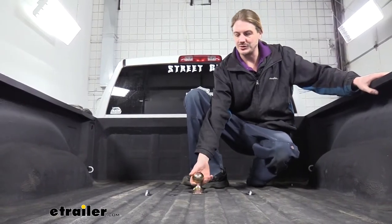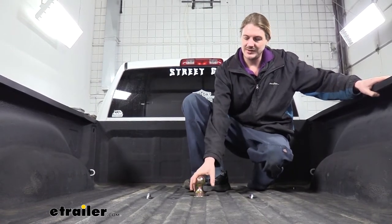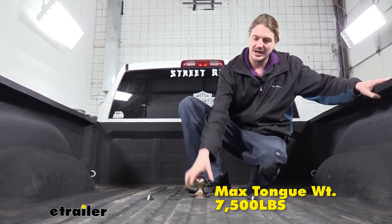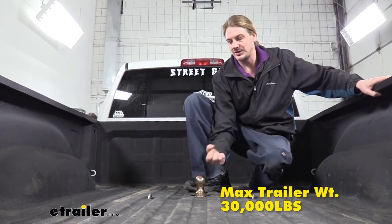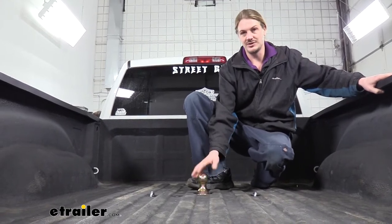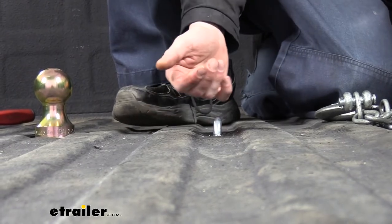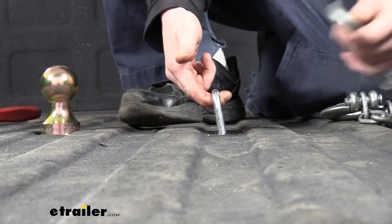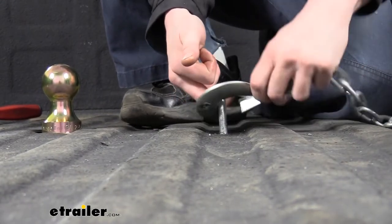This hitch is going to allow you to haul your gooseneck trailer. The ball that comes included is a 2 and 5/16ths inch size. This hitch is going to have a 7,500 pound tongue weight, which is the force going down on top of our receiver, and a 30,000 pound gross towing capacity, which is how much it can pull behind it. I recommend that you verify in your vehicle's owner's manual and ensure you don't exceed any of its towing capacities. The safety chain loops that come included are spring loaded, so it keeps them flush down into the bed when you're not using them. When you hook up, they simply pull up, and you've got a nice large opening that should accommodate just about every shape, size, and style of safety chain.